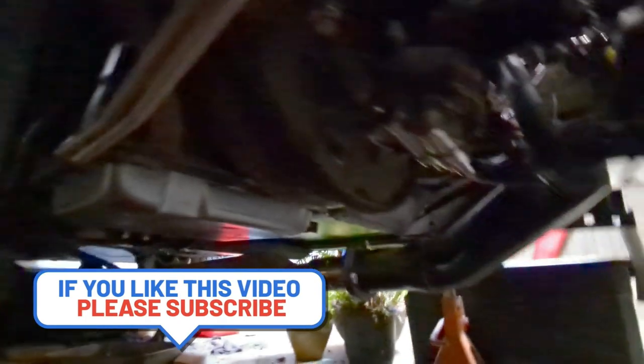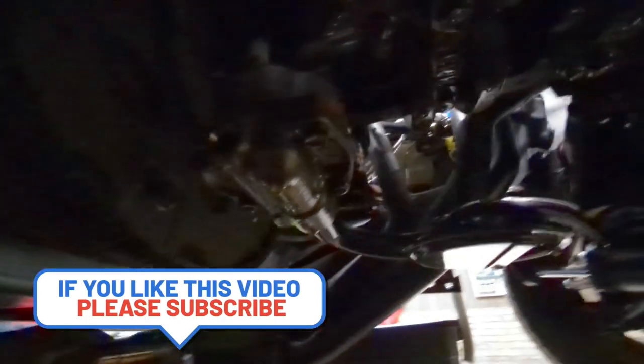All right, it's a little dark under here. I'll back out so you can see a little bit. This is the underneath of the engine with the oil pan taken off. Now, I got up underneath here with a flashlight. I know it's really hard to see, guys. I'm just showing you. I inspected everything and could not find a single flake of metal on any part in here. Even the screen. I checked the screen. There were no metal fragments, nothing that I could see.